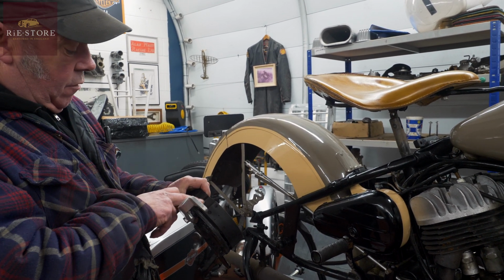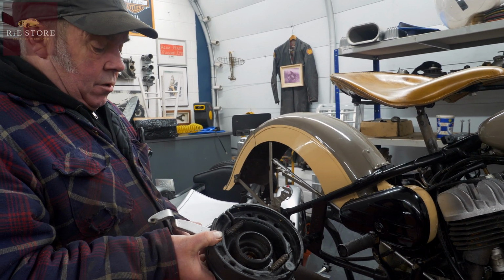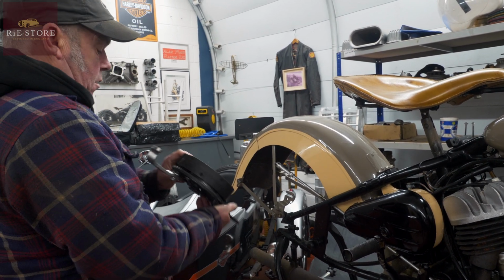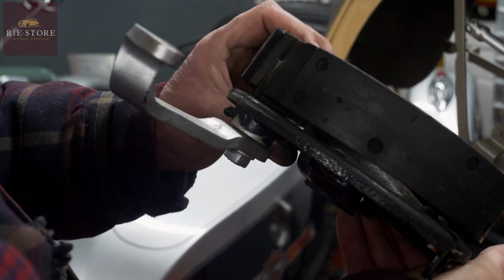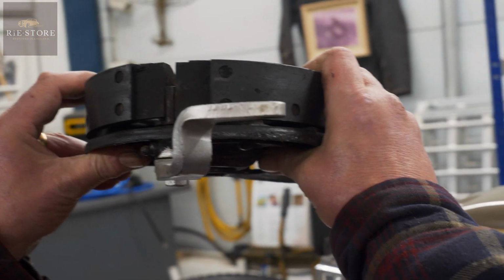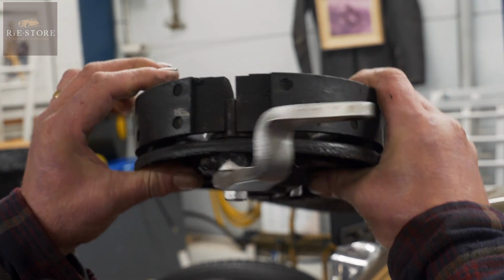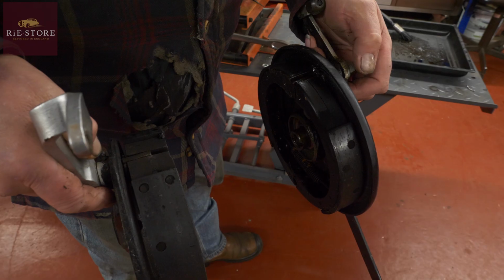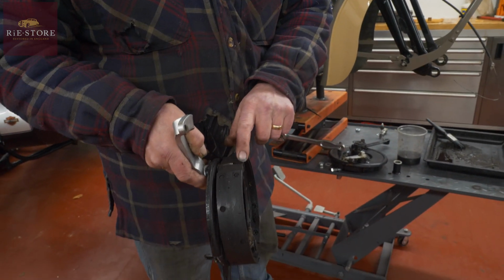One thing I did notice, that's the wrong actuating arm. One, it's the wrong actuating arm, and one, it's fitted in back to front. So what it does, the rear brakes end up, if you look at it, and that spring's on the wrong side. It should always be on the back, the springs, and it holds the shoes like that. I see they're sort of pointing upwards a bit. That is a front brake actuating arm, where the shoes are narrower. You look at that, see they're a lot narrower. So that should go all the way up to there.